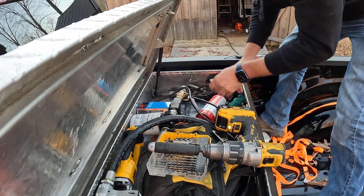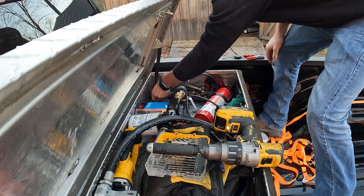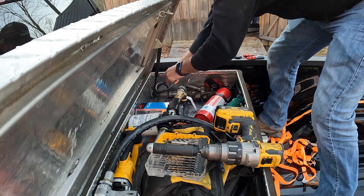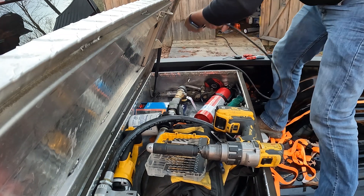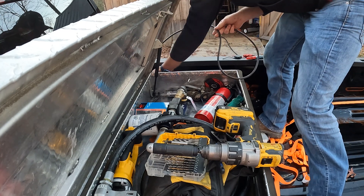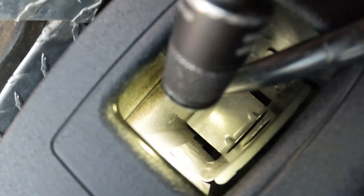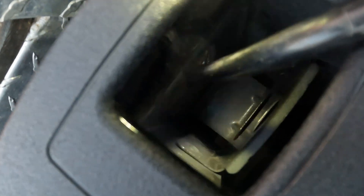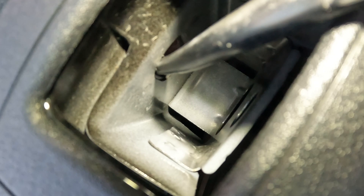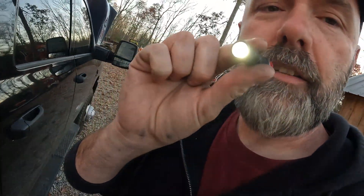The wire has an inline 25-amp fuse which should be good enough to run off the auxiliary switches. I'll use a step bit with an angle adapter on my drill to knock a hole in this toolbox, then run the wires through the little hole in the stake pockets in the bed and drop it down. That was quicker than I thought — the hole's big enough. I'll run the wire out of the toolbox into the hole in the stake pocket and down one of the little slits on the side.